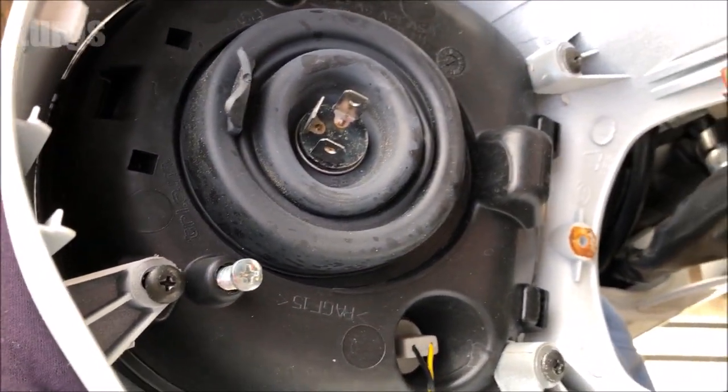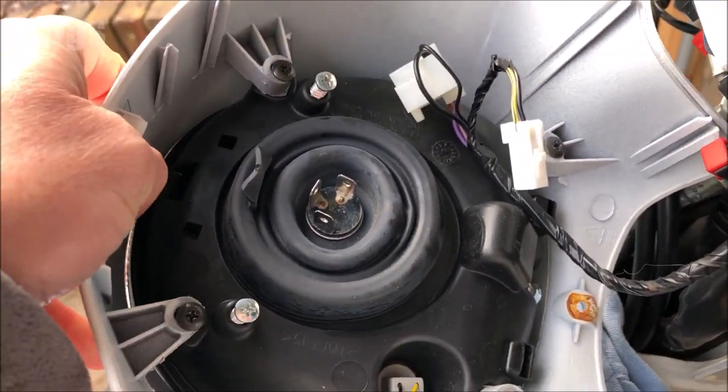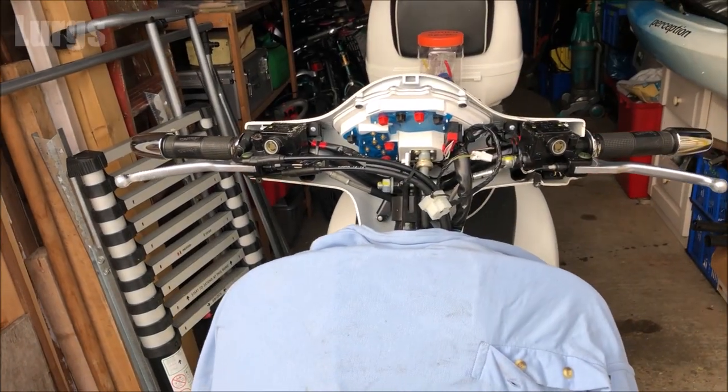This is obviously how you replace the bulbs — it's a right pain if you want to replace the parking bulb or the main headlight bulb. Remove the parking bulb first: just push that little clip in and then just slide it outwards. Then remove the main headlamp bulb plug — this just literally pulls off, just wiggle it. So this headlamp unit is now free. If you're going to be replacing it with a brand new one or a secondhand one, what I did is remove this one first and then compare it with all the photos on eBay or on the internet just to make sure when I ordered one that it was absolutely identical.